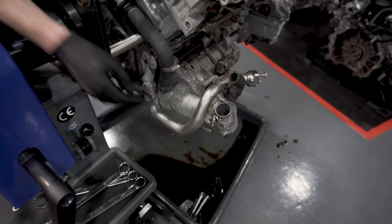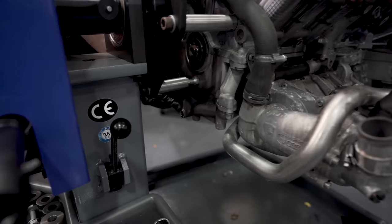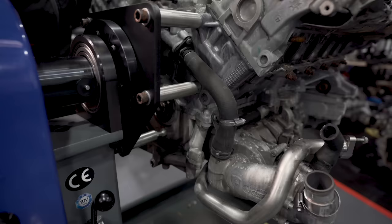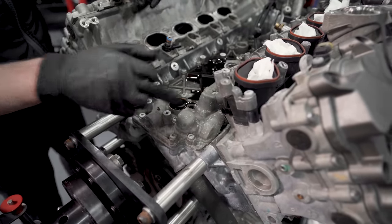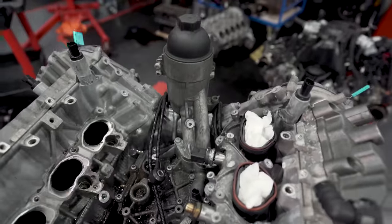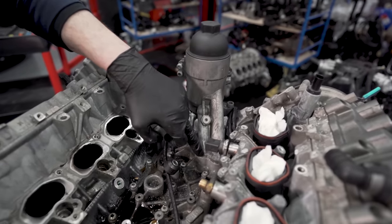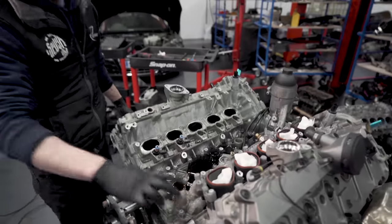So, the oil comes out of the oil pump, up the front, up this pipe. Where I've got that plug out is that section here. Comes up the front, up through this hole, through that hole here, up the front to the underside of this port. That's the thermostat, that either leads it through the oil cooler or along this hose, this casting. Under the oil temp sensor and up the oil filter housing. Through the filter, down through the center of the filter, down through this port, and then it goes into the bottom of the gallery, into the center of the crankcase, where it then shoves it where it needs to go. So that's the oil feed up.